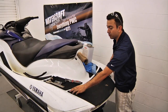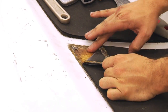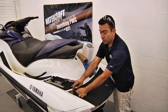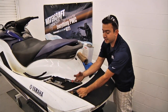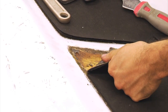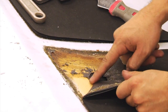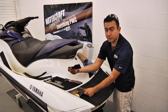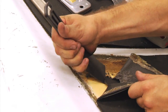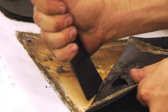You need to start peeling off the sides of the mat to expose the glue underneath. Once the glue is exposed, we'll scar it a little bit and pour the adhesive remover on it so it starts to dissolve the adhesive and we can wipe it away. Using a scraper — whether plastic, metal, or a razor scraper — helps to separate the mat from the glue itself.